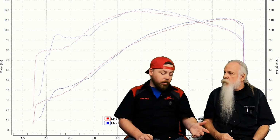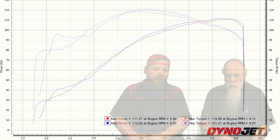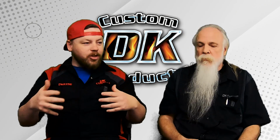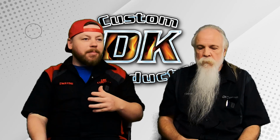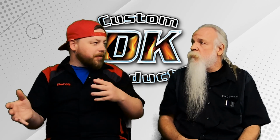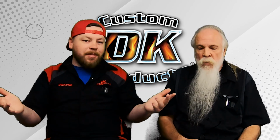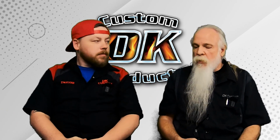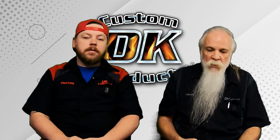Right. And then also worth noting, even though it's not as relevant because horsepower doesn't take over until 5,200 RPM, you get the edge with the Thunder Torque inserts over the SuperTrapp style. But, you know, this is just semantics. A lot of it is your riding style, how you ride, where you want your power to be. But, you know this, preventing reversion is key to optimizing performance. Right, and both of these exhausts are very good at preventing reversion.